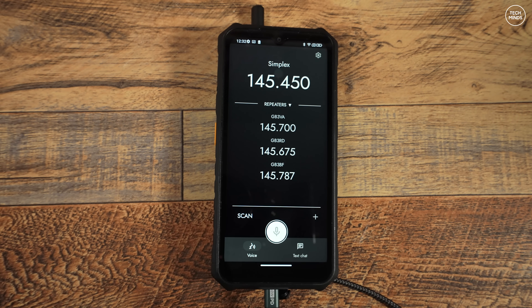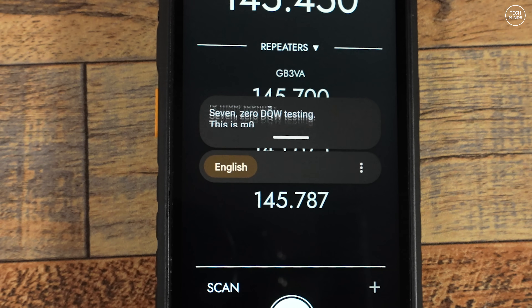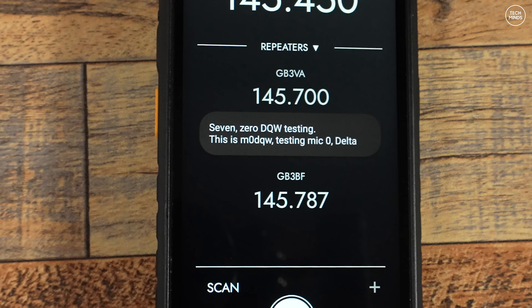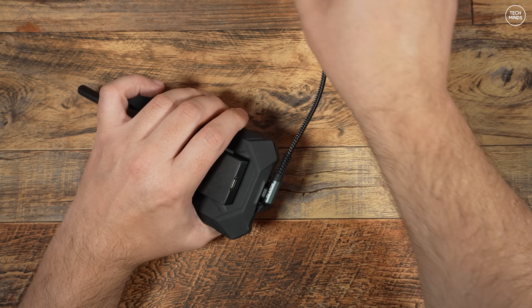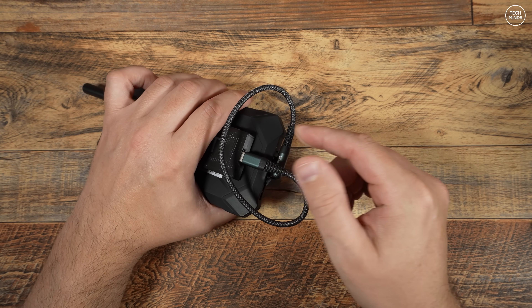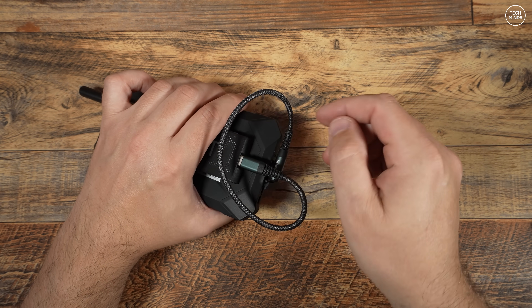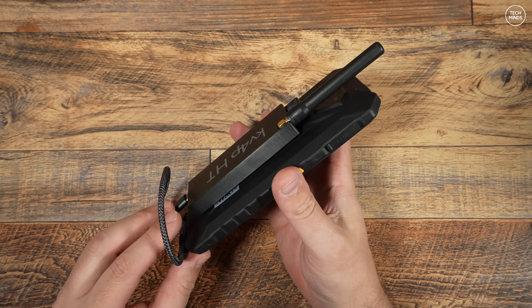On the settings page earlier we saw the closed caption settings. If enabled, your Android device will transcribe the received audio to text on the display — and most of the time it does actually appear to work okay. One last thing to mention: my Android device is too thick to use the recommended USB-C to USB-C OTG adapter. So if you find this is the case with yours, then you can use a short USB-C to USB-C cable like I have here.